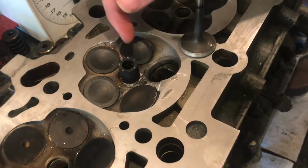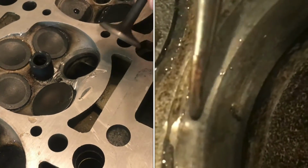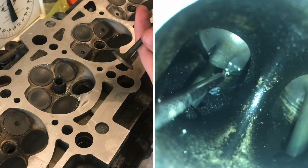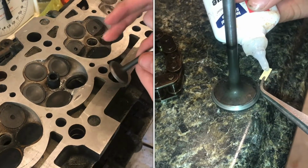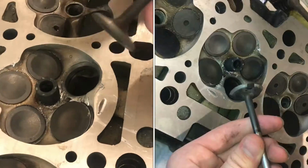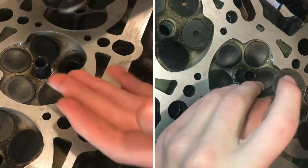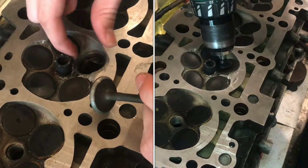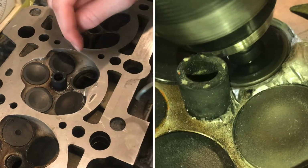In this valve seat, there's a nick, and that's causing the valve to leak whenever we do the water test. So if it's going to leak water, there's a good chance it'll leak air. So we need to get that out of there, and in this case, the valve is super compact, so you can't, say, make a jig with blades or some kind of grinder that'll fit in there, because anything that's even a little bit larger than the diameter of this valve won't fit in there.